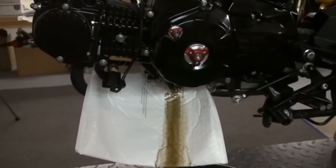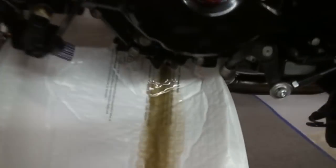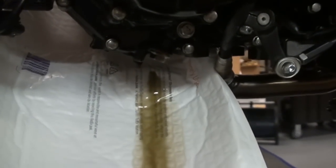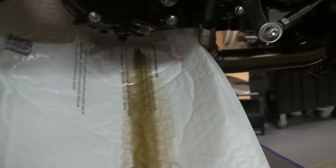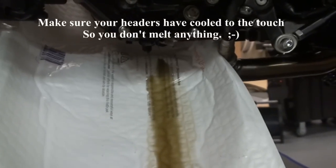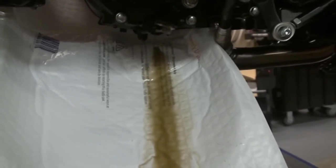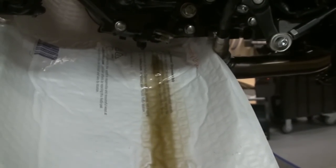First step is to warm up your motor — it doesn't have to be screaming hot, just warm it up a little bit. Then go ahead and drain your oil. A nice easy way to drain the oil without making a mess: you can use aluminum foil or a soft pack baggie like we did here — you can get these from the post office or FedEx. Anything that basically routes the oil over your header so it doesn't drip all over it, because oil on your headers will smoke and stink when you start it up. Once your oil is drained and it stops dripping, put your drain plug back in, preferably with a new crush washer, and tighten it up.